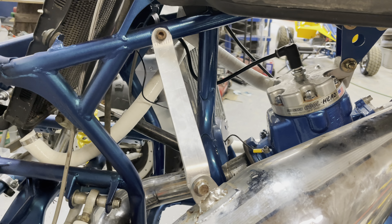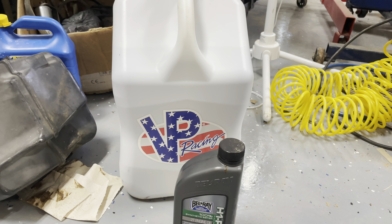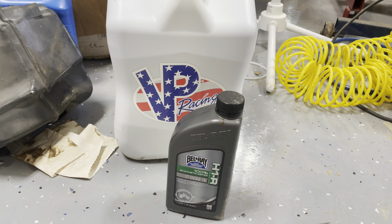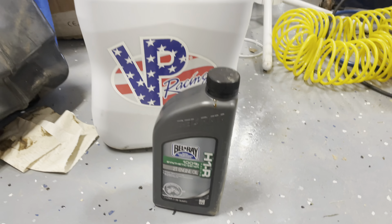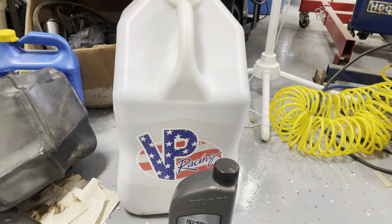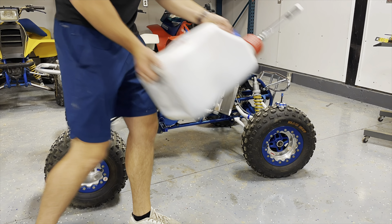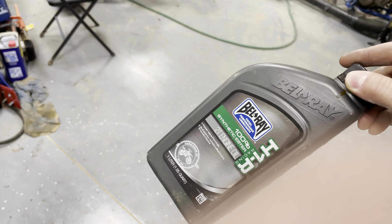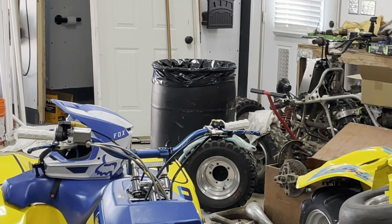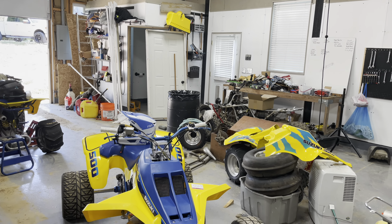That is one makeshift bracket. I've got to mix some more gas for project LT 250R — I ran 110 octane and got rid of the old gas in the tank. Just a reminder: for a 32-to-1 two-stroke mix, that's 20 ounces of oil per five gallons, or four ounces per one gallon. And the most crucial part of every build process — will I make the H1R empty bottle into the trash can all the way across the room? Totally nailed it.